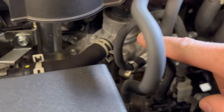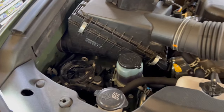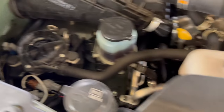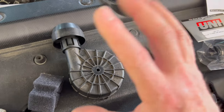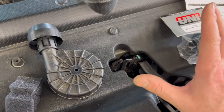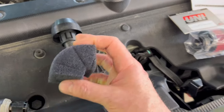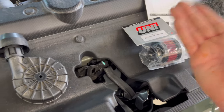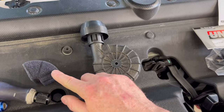This is a switching valve right here, and you do of course have another one on the opposite bank. So this doesn't just affect the pump — it could potentially affect those switching valves as well. When you do install this filter, do not reinstall the old one, because the key here is knowing the condition of the filtration system to this pump. You will then rely just on the new filter — no longer on that old one.